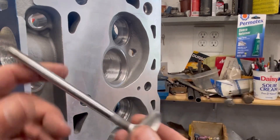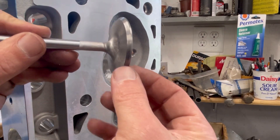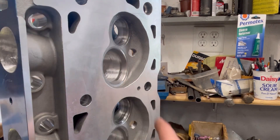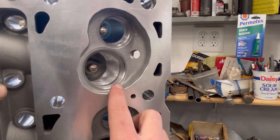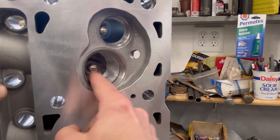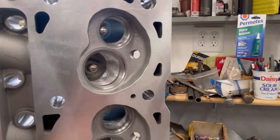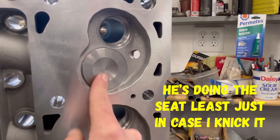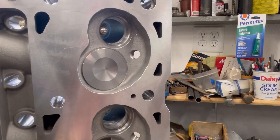What we're going to do here is the first step: we're going to grind these valves down. He's got a really cool valve grinding machine. He's going to go through and regrind these valves to make sure they actually hit the seat. Then I'm going to get all this cleaned up, and after that Jimmy is going to regrind the seat on these, so when we put this in and it's going back and forth, it's got a proper seal.